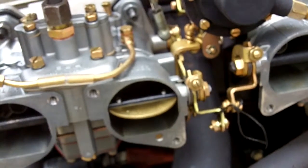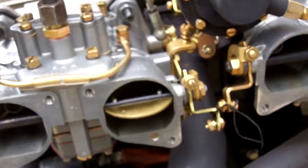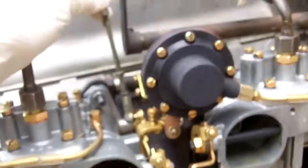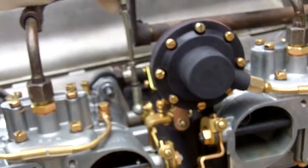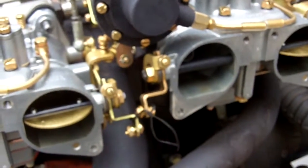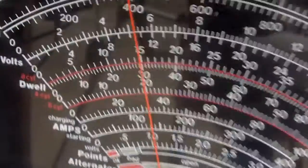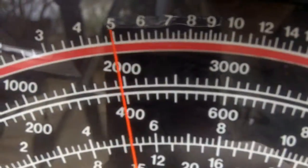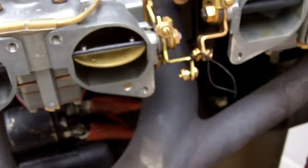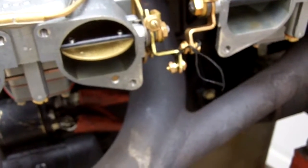Just for fun, let's see if we can go even lower. An eighth of a turn on each screw — we've got an indicated idle speed of 400 RPM. Now I'm going to hook the linkage back up and we're going along at 400, actually a little bit less, about 400. Which is very hard to do because fuel is very heavy — the air-fuel mixture is physically heavy and we're drawing very little air in to pull the heavy air-fuel mixture in.